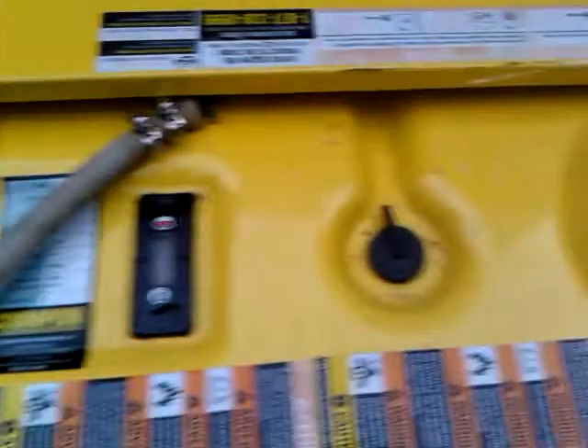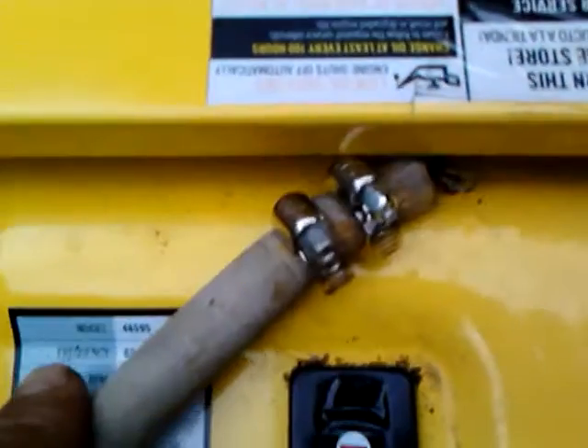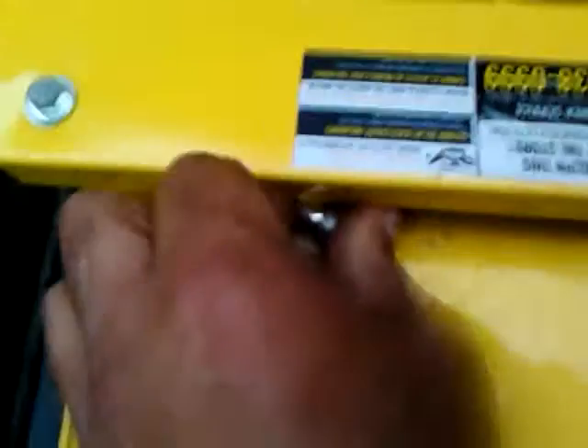This is the easiest one I've ever converted. Up here there's a vapor line that used to plug in right here. I just got the line stuck in there, inside of this fuel hose — the fuel hose off of the old one that I had — and it just goes down to the breather box.